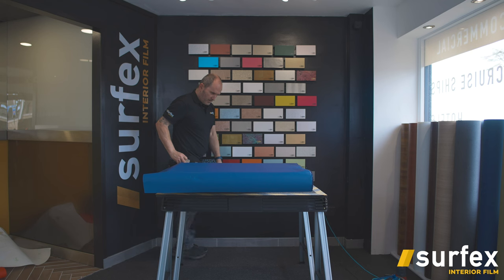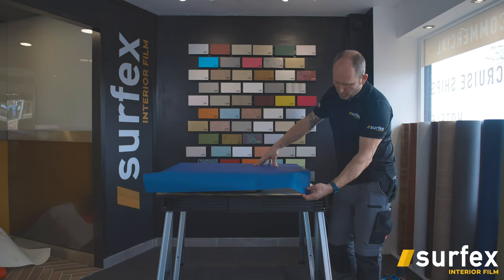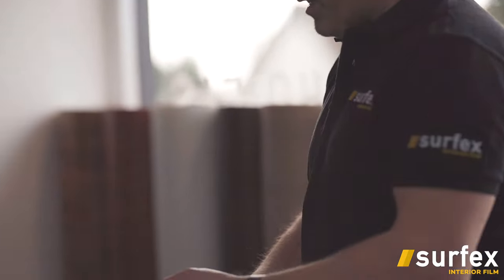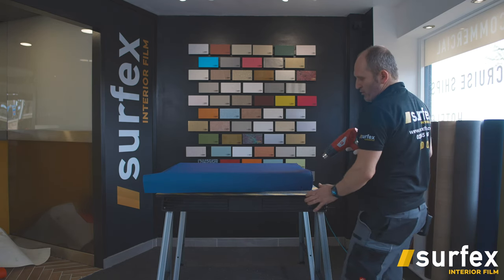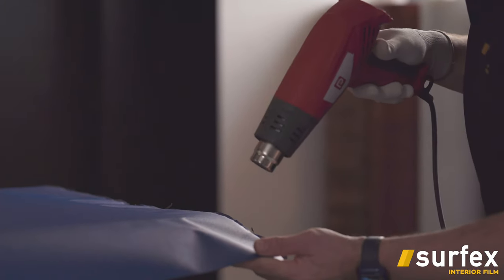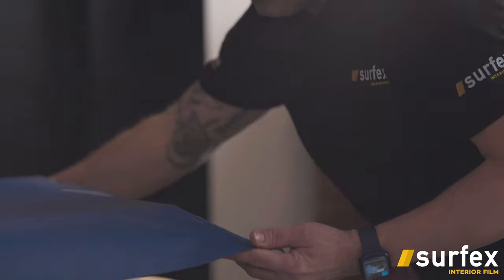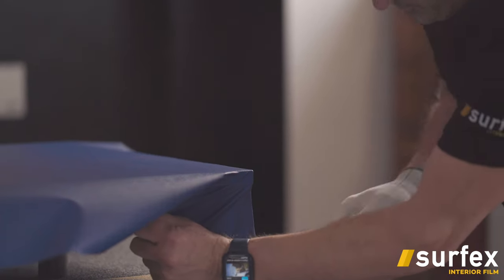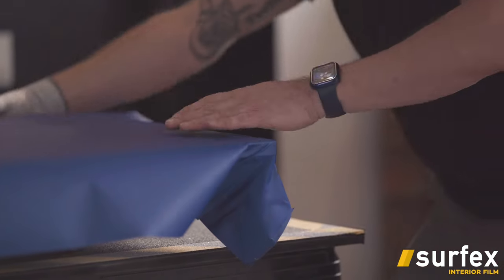So now that's fully wrapped, what I've done on this door is just put a little stand underneath so that your vinyl hangs down. So I'm just going to put my wrapping glove on and heat the corners up and show that what you should be able to do is do it so it can all heat and then you won't have any join. And then just give it a full stretch so that you've actually got that edge all in one.